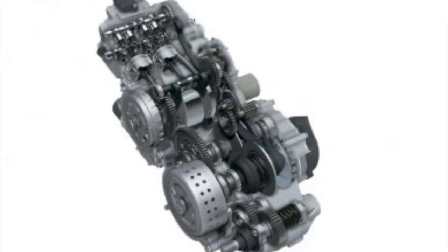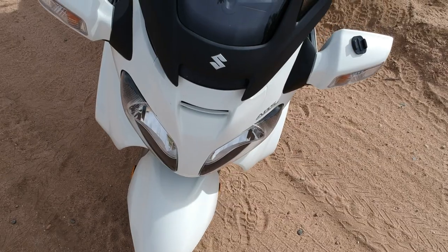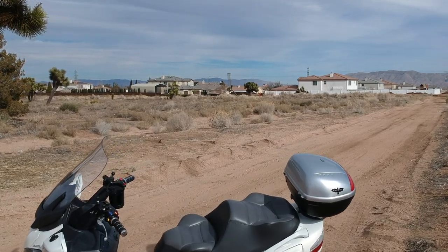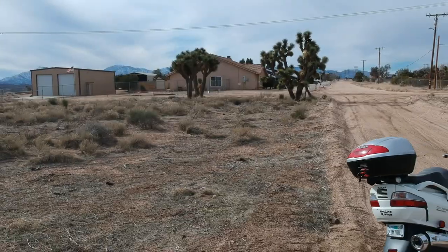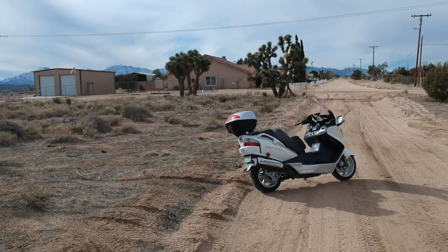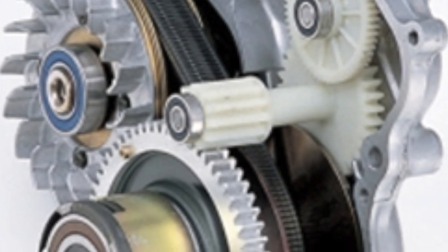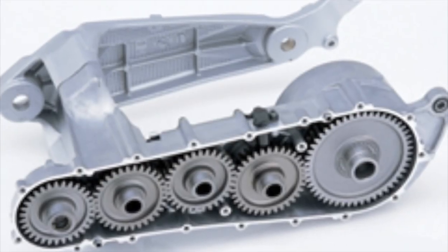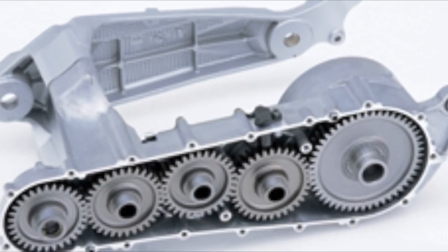It's got a digital electronic ignition and electric start. Max power is 40 kW or 55 horsepower at 7,000 RPM. Max torque is 62 Newton meters or 45.7 foot-pounds at 5,000 RPM. The transmission is an electronically controlled CVT, and the final drive is listed as a V-belt, but it actually has a gearbox that feeds from the V-belt back to the rear wheel — so that's a bit of a misnomer. You do have a gearbox with gear oil.